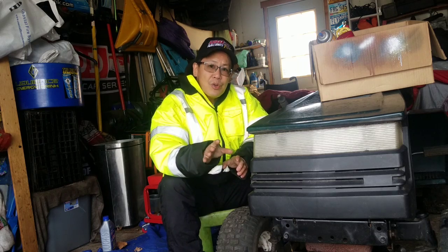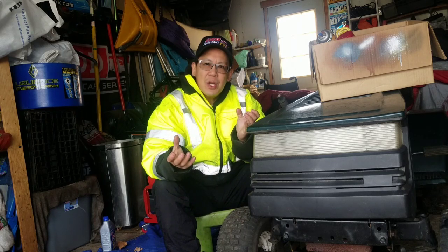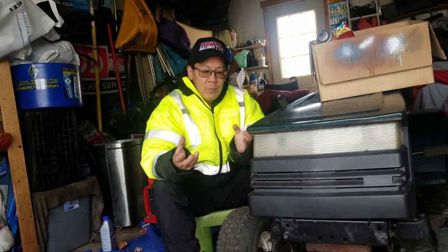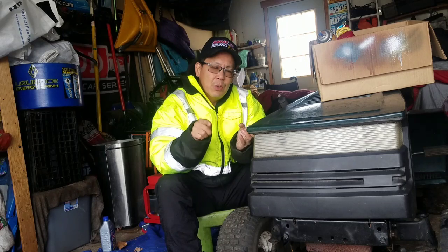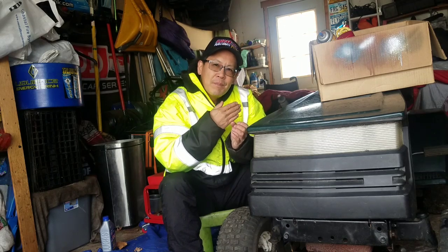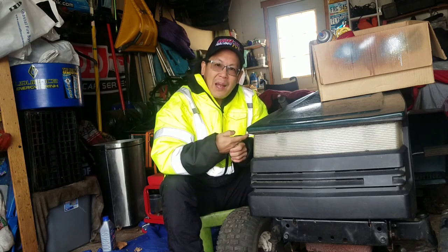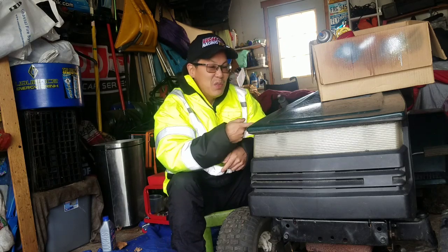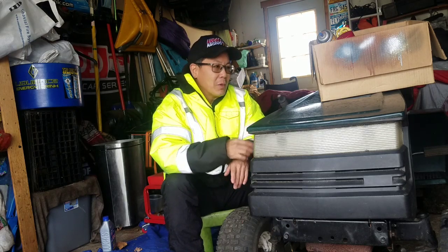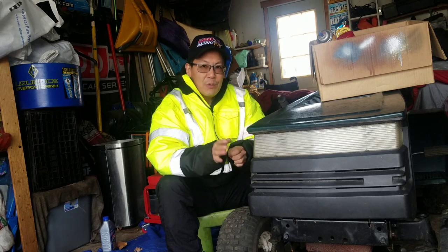Anyway, so I was looking through those videos, right? And as you guys recall, when I was putting this thing together, I had that other crankshaft, the 15 horsepower crankshaft from my shed. It looked identical to the one in here, the 17.5. But then I was watching it carefully, pausing the video. The top flywheel keyway on that crankshaft looked angled in a different spot. It looked like the same spot that I need this to be. So I think if I put that crankshaft in here, it would be perfect. I think the crankshaft was wrong in this engine. The flywheel's fine.